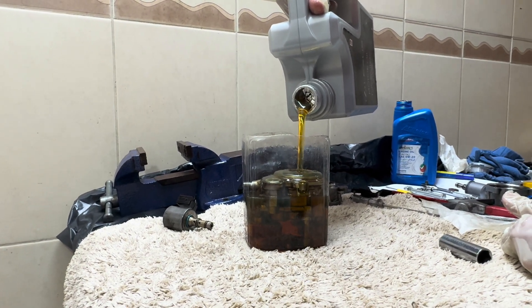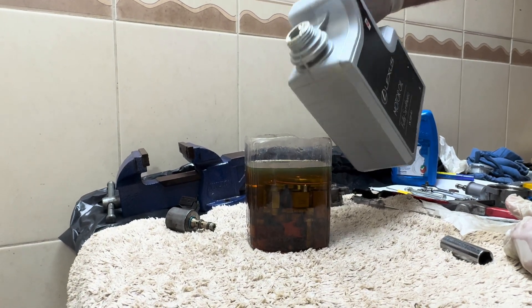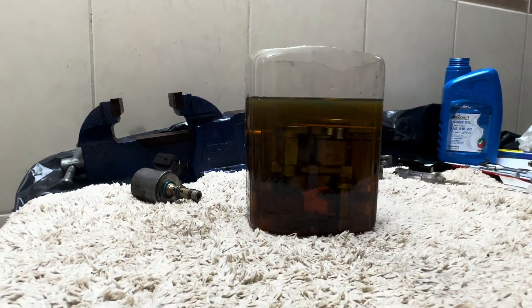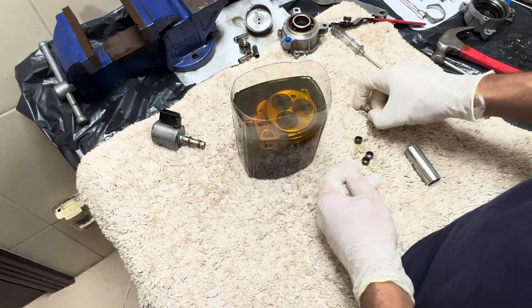As you can see, the solenoid has been removed — the electrical solenoid — because we're going to dip it completely in oil. The high pressure fuel pump has to be cleaned properly before doing this procedure, because as you can see we are dipping it completely in oil. If it has any residue it will come out. Now it's time to install the springs for the pistons.